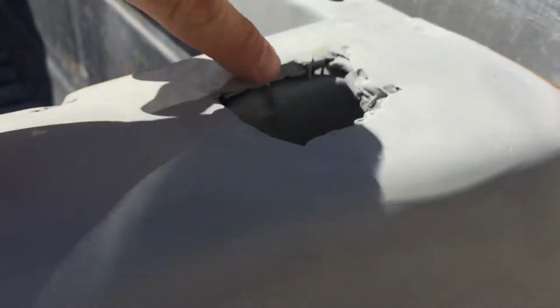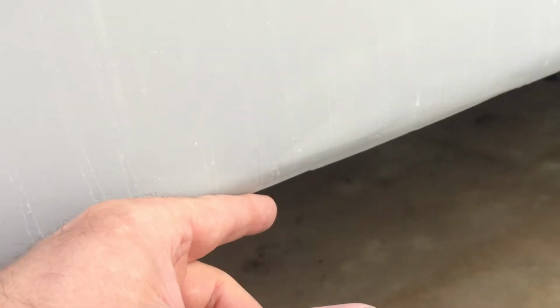If we did do this, we'd want to definitely feather out or clean out that hole, assuming we keep these panels, unless we get rid of them. Again, not opposed to getting rid of the panels and replacing them if that's the better option and more cost effective or time effective. Underside back of the cab, a couple areas to point out. From about here to here is rusted out. I did grind it and put some Rust-Oleum spray in there, and then I backfilled it with fiberall again. It has a piece of chicken wire mesh in there to help reshape it back into place. If you sanded it down enough, you could maybe start to see it show through a little bit. But for the most part, that also has metal glaze on it.